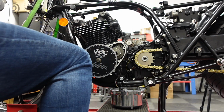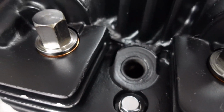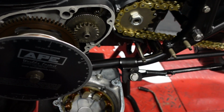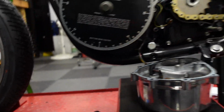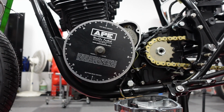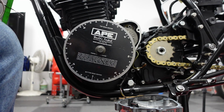You see, I can see the exhaust valve. You see here, you look down on the spark plug hole, you can see the exhaust valve right there. And I don't know if it's going to focus on it. Let's see. See a little mark right there? That was the exhaust, the valve hitting it. So, well, what do you do in this case? The valve is contacting it. Let me play around with this a little bit.